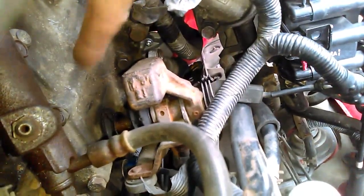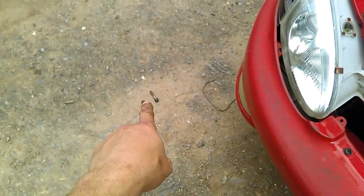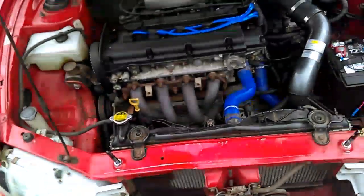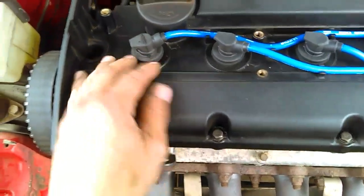The starter is on now — I didn't even show that part. It's on with both bolts now. You can probably see the little 14mm right there — so it's got both bolts. I did find some bolts that should work for the couple missing on the transmission, but the parts car is right over there so we might as well just pull them off that so we know exactly which ones they are.